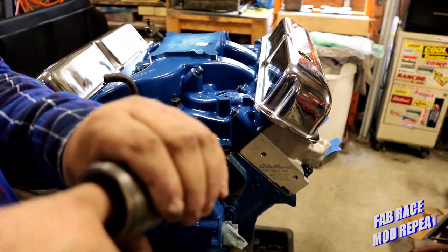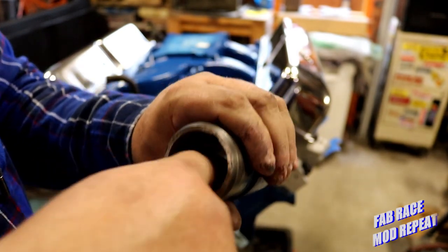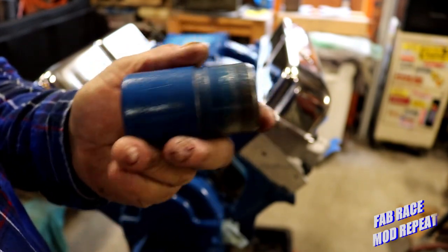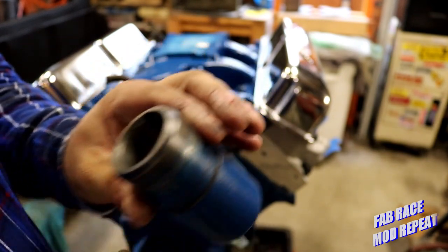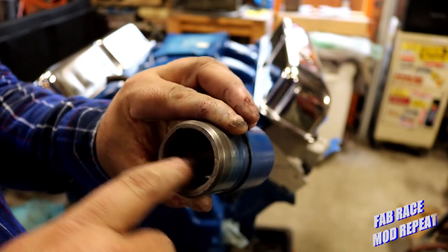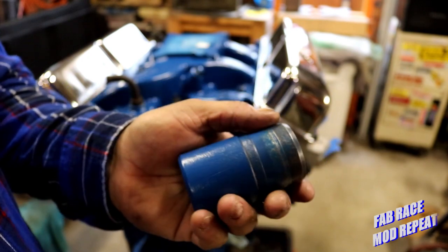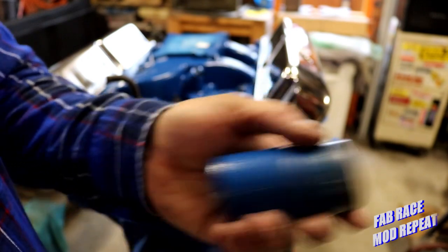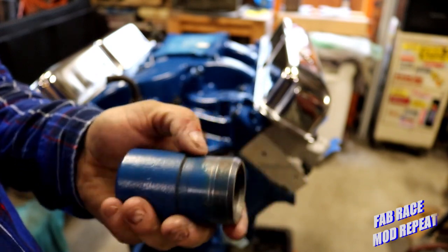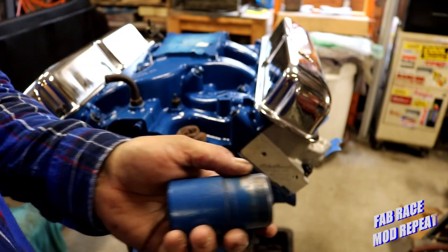Then somebody will go, let me take a brake hone or a cylinder hone or a little dingleberry hone or whatever and clear it out some. Now it's too loose because there is a tolerance to it. I don't have anything in my old Ford books that shows what the tolerance is on this, but I know that it shouldn't wiggle when it's on that crankshaft. You can pull it on and off with your hand — you have no reason to drive these on. They should just slide right on and slide right off with a minimal drag to them.